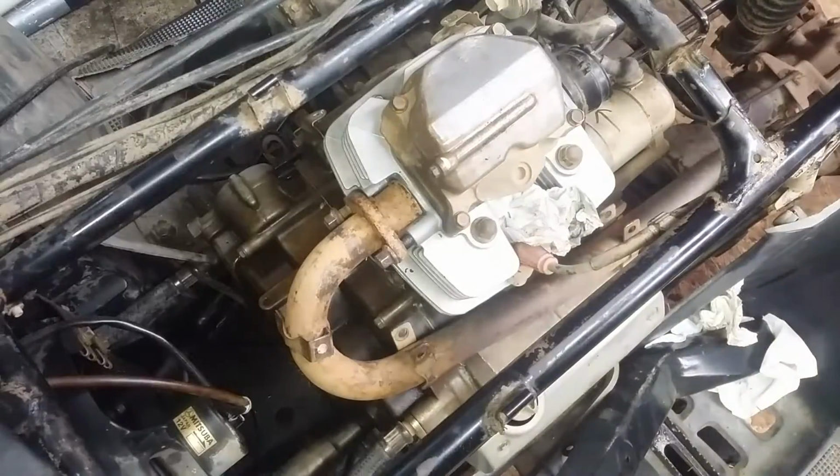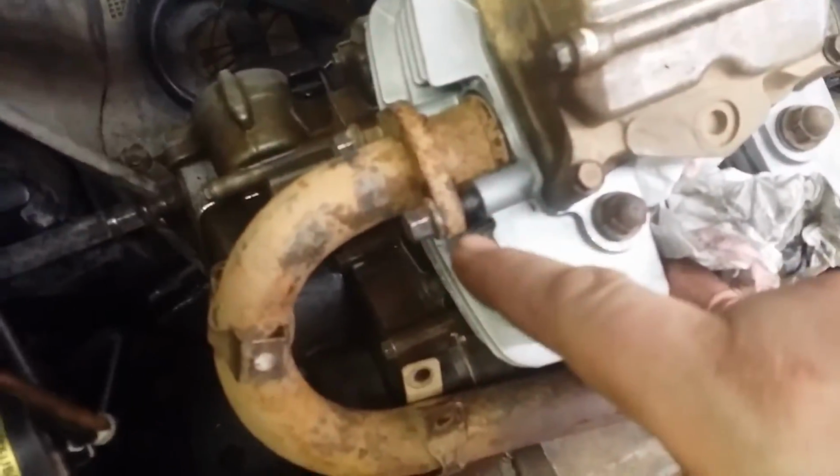The muffler, you got to come from the other side. If you excuse the clicking. Alrighty. You see I have the header connected up here with the bolts. Comes around, feeds through this section of the frame. It's going to sit more about up a little bit, kind of floating here. Now the muffler here has these two flange bolts here. These rest up in here on these two studs. And then the back of it, of course, is going to connect up to the back of the header pipe right here. Let me find those two bolts, or the two nuts that go on here, and I will be right back.